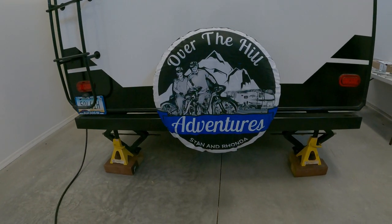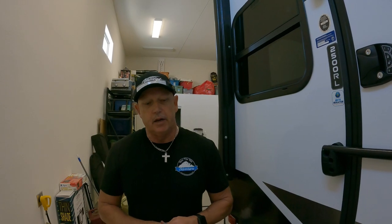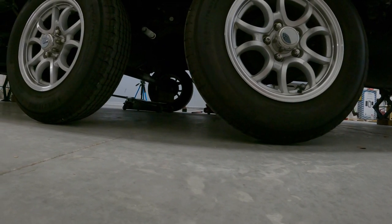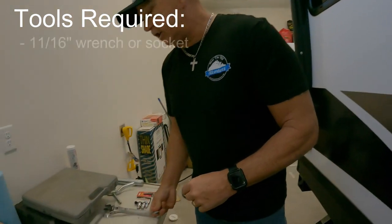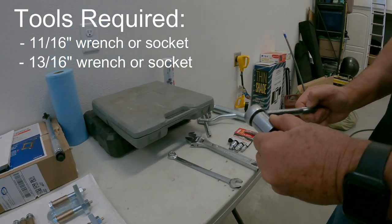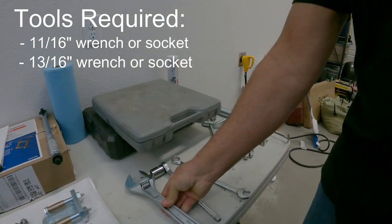Make sure safety first — make sure you have jack stands and that it's well supported. The best way to do this job is to have all four wheels suspended. I brought them up just a little bit so the tires on the other side are just off the ground. I've already broken the bolts on the tires while they were on the ground, so you don't have to worry about that — because if you didn't, your tire would spin and it would be really tough. We're going to go ahead and take the tires off, but first I want to go over some of the tools.